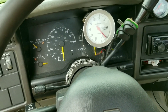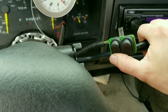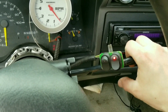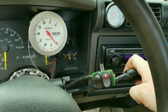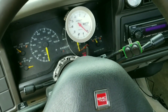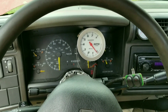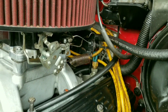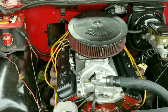People ask how the rest of the transmission works — like how do you put it in reverse? Well, the only thing you gotta do is start the truck. Reverse is always going to be reverse, that's neutral, and then you put it in overdrive. This right here is first-second, this is third gear. When you want fourth, turn the first switch back off. If I had the torque converter wire hooked up, I'd have another switch for that. It's just a 625 Demon carburetor — that's it.